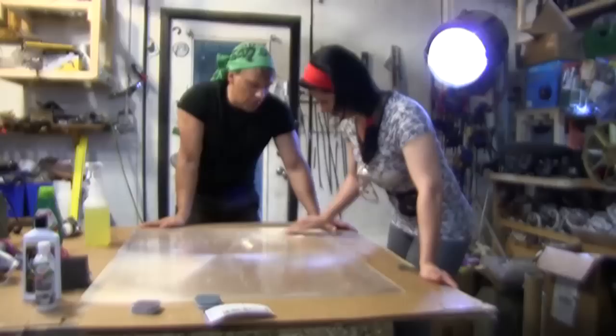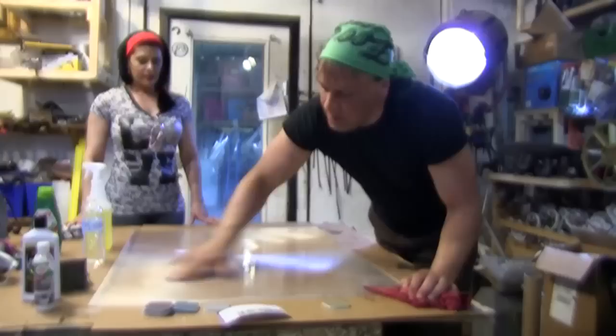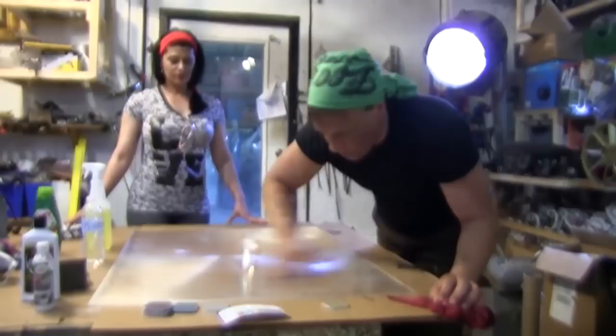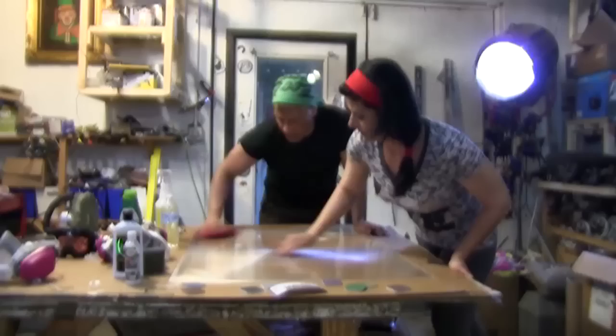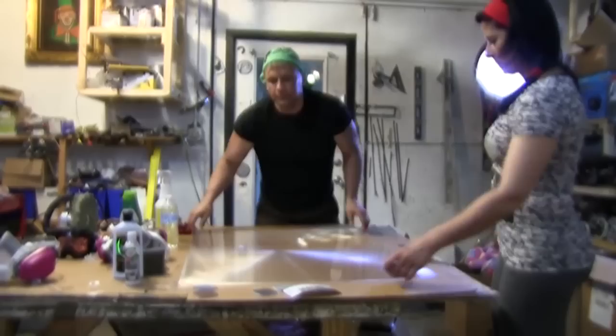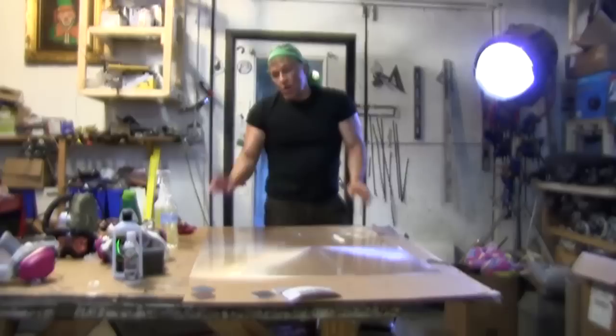We're doing the 3200 right now. By stepping up with the different sandpapers it takes longer, but it will save you so much time in the long run. We're up to 8000 now — it's not going to have the same sound as with the thicker grit. These pads will hold up for about three or four lenses, so if you're just doing one this is a great option. I'm going to go ahead and wipe this down and show you where we're at so far — with the micro mesh this is what we've gotten. It looks pretty good; this will actually work in the sun. We're going to take this outside and buff it.